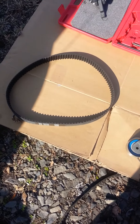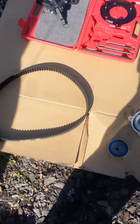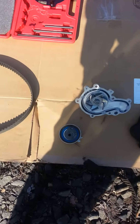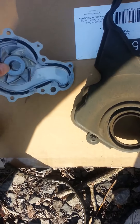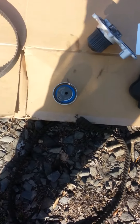These have been checked out and appear to be okay, so I'm going to go ahead and put another timing belt on. While you're at it, you're going to want to get a new tensioner pulley and also another water pump, because those will also lock up and the bearings will go out in those tensioners.